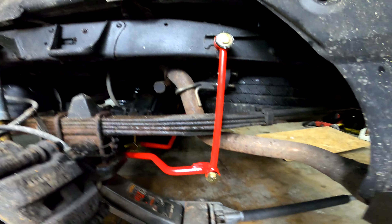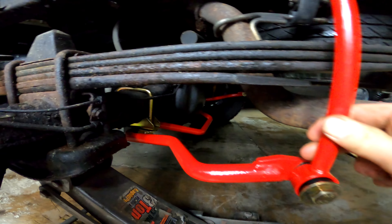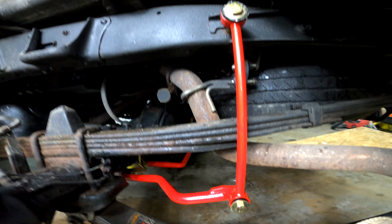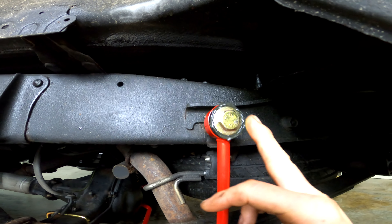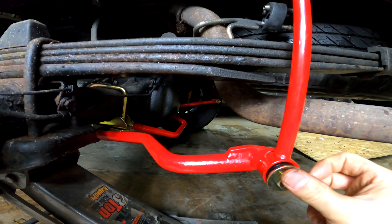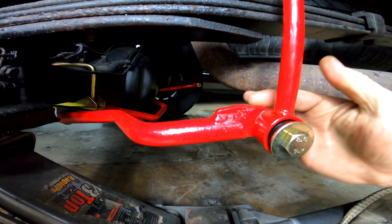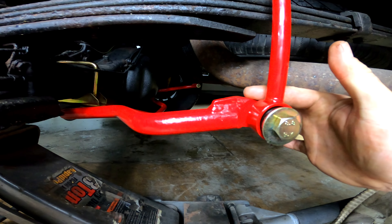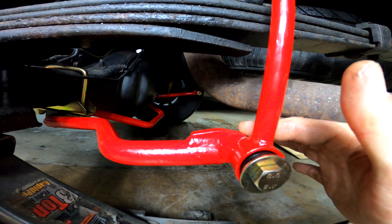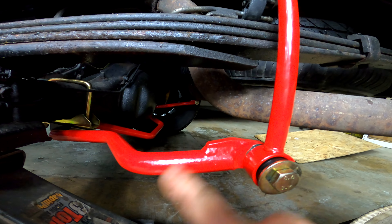Here's the final money shot. Have everything in here loose — just let the bar kind of sit where it wants to sit, and then work your way down tightening everything. The top is going to be 84 foot-pounds and then the rest is 48. You can round up to 50, that's fine. The only thing is you've got to install the bar the correct way — there's a flat top up here. It says to install the TRD logo up. I don't have that anymore, but I put it the other way and it just didn't sit correctly, so hopefully this is the right way with this flat top up.